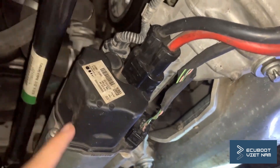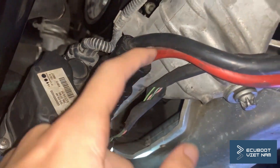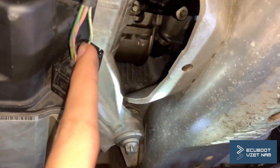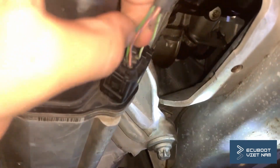This is our electronic power steering — basically it's a motor mounted on top of a normal steering rack. There are two big wires going into the module to feed the electric motor, and there are three little wires going into the module: a wake-up signal wire and two FlexRay communication signal wires.